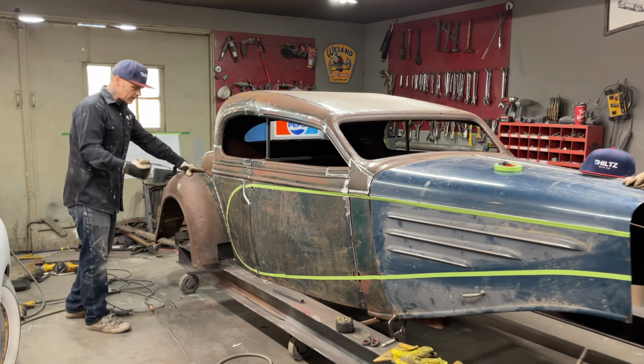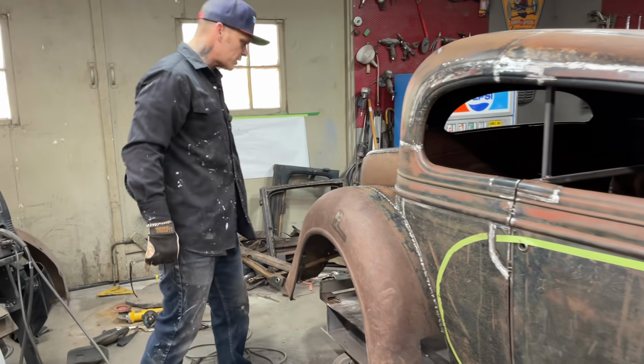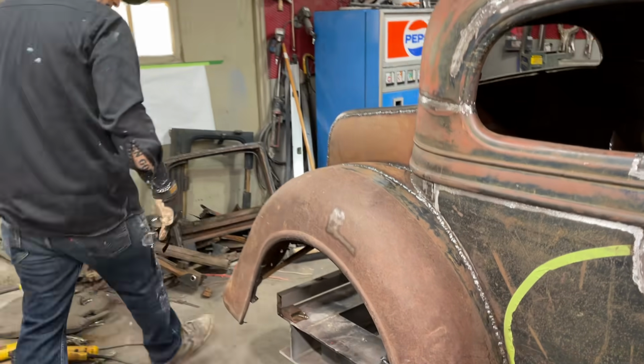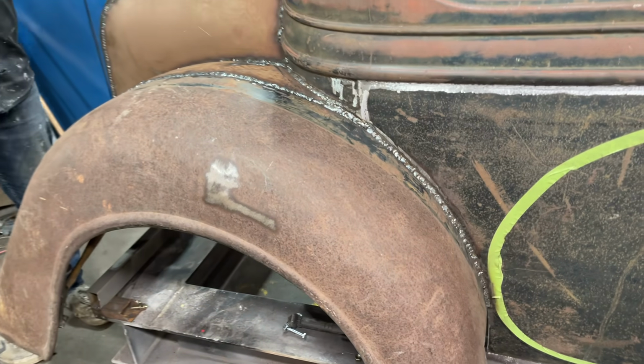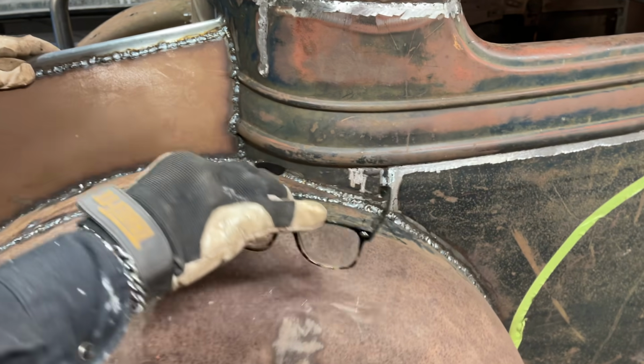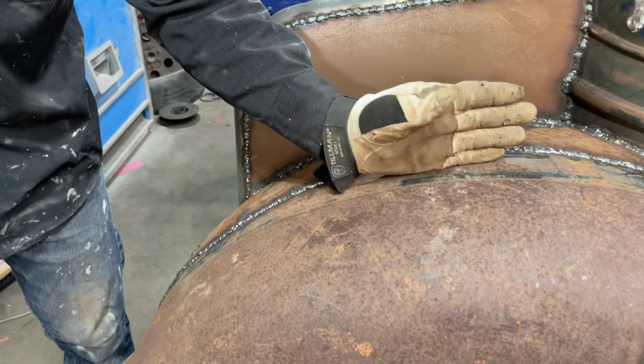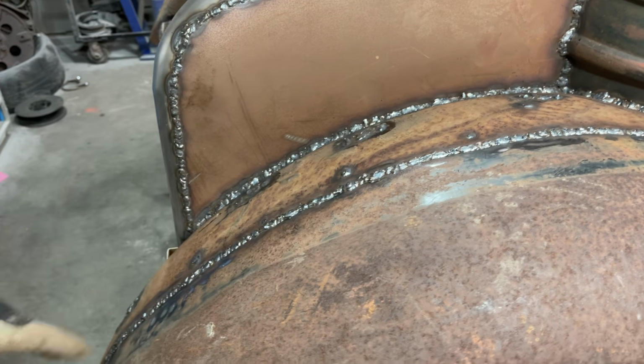After the video was shut down, I continued on welding this fender on. You can take a look at it. That's what people generally want to see, how everybody else does it, and I'm going to show you how I did it. Wherever the coat hanger was needed, I used the coat hanger in there. There's lots of weld on that, and I think I explained before I started, I like to weld on this side and take it over to the ledge so we have something to feather.